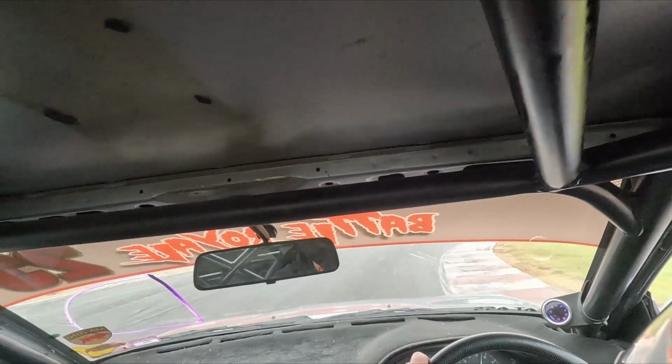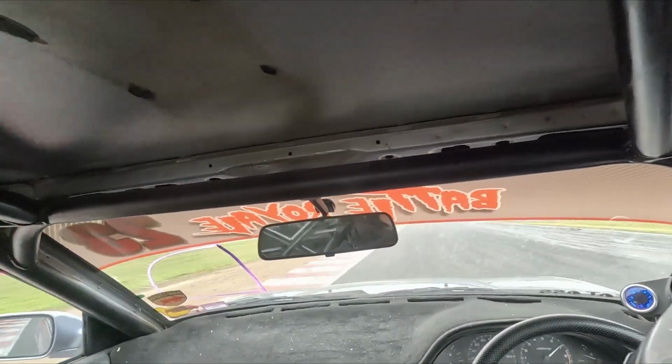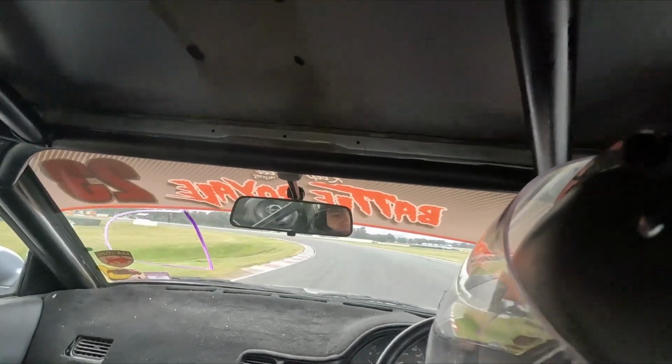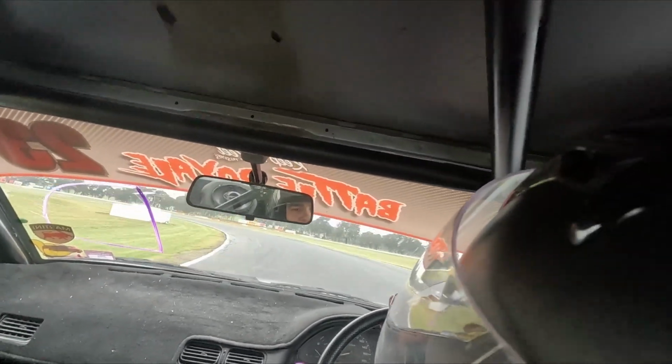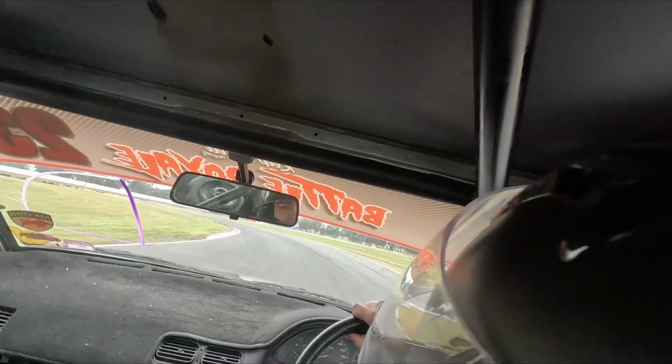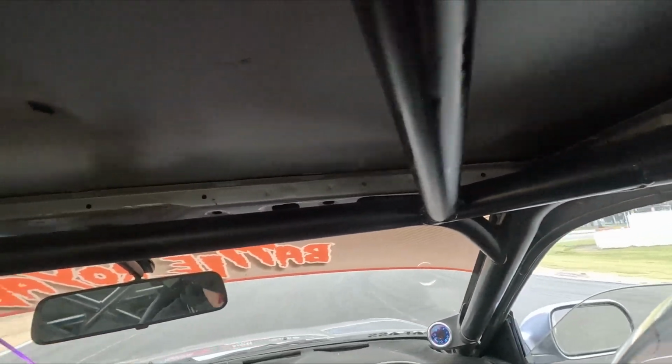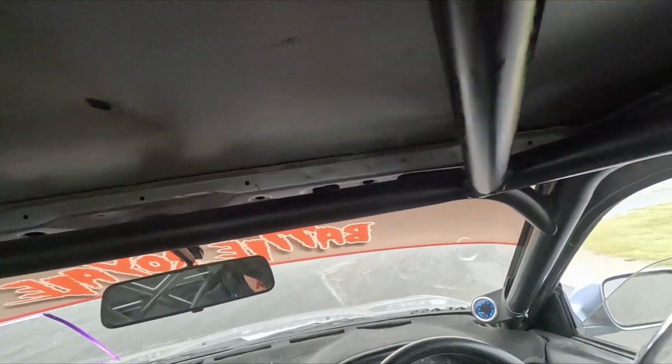In case it isn't painfully obvious to see, we are fighting a lot of understeer. We've got 255/40/17 fronts, and 295/35/18 rears. On top of that, we've got 9 kilo front springs and only 4 kilo rear springs. So, very much not the right suspension setup for the tyre combo.